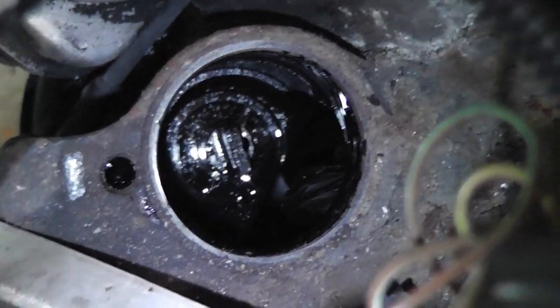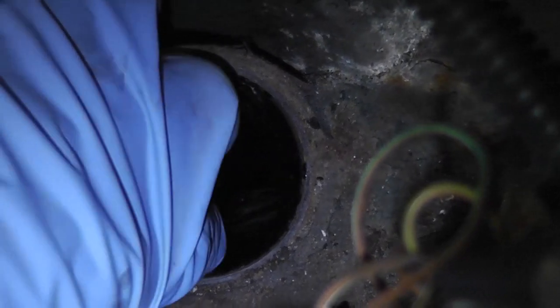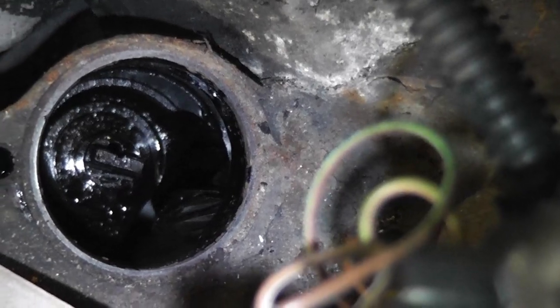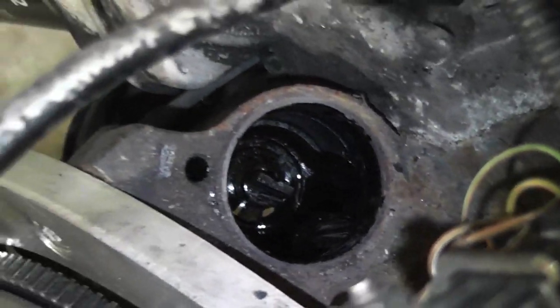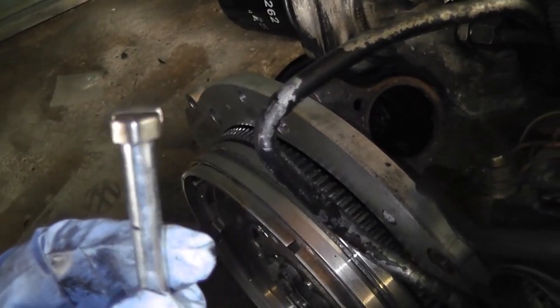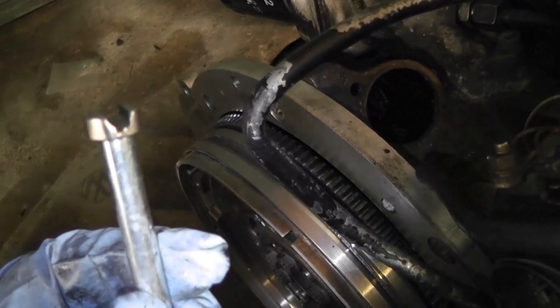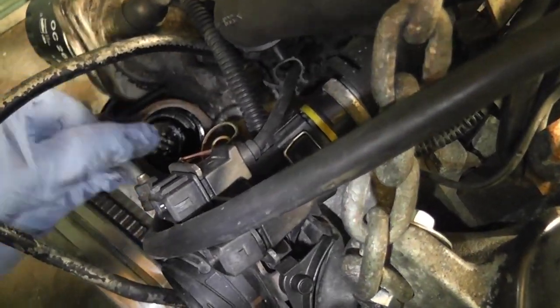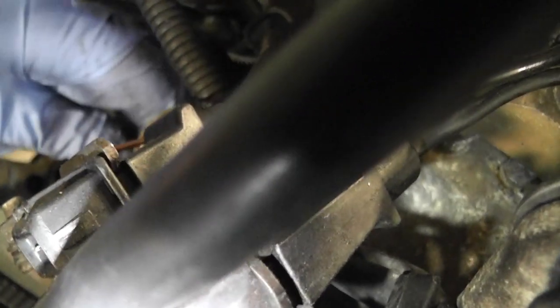What you're looking at there, the little drive dog, is the top of the oil pump. Now, what I have done is I've made up a tool for actually turning that with the drill, and then that's going to give us the oil pressure, right? So the tool is basically this lad here. The bolt, which I've ground down the hexes on and cut a slot in the top. It's quite a long bolt, see? So what I can do now is put that bolt into the drill, and that will just go down over the drive dog of the oil pump, like so.